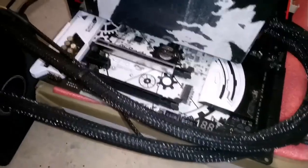Watch this bad boy. Oh, nope. Now it's doing it. Probably because I threw an overclock at it. Usually that chip boots at 3600. Making a liar out of me today. Let me try something real quick. Sometimes your memory is not seated properly on these stupid boards. It's probably due to the fact that I tried to throw an overclock at it. Well, let's find out.